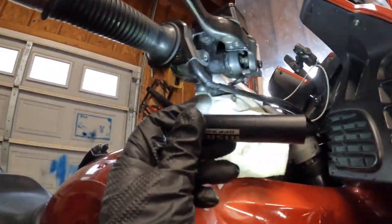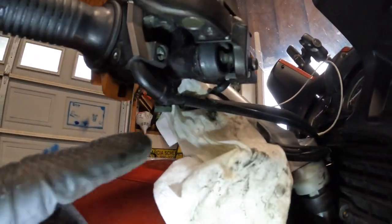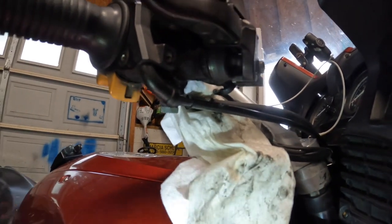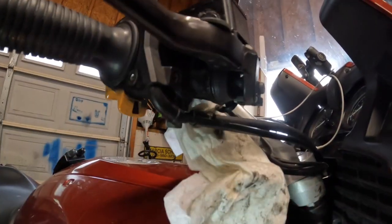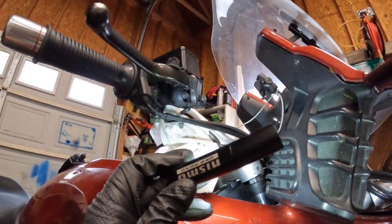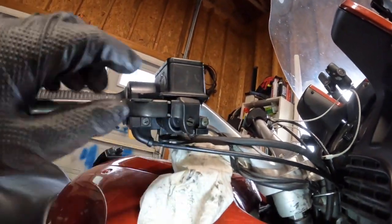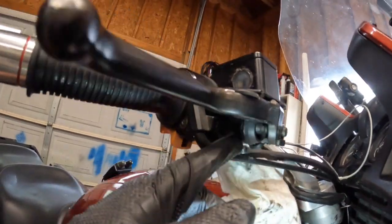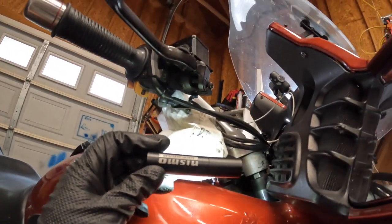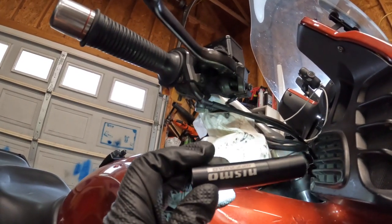Alright, I hope you can see up under here. You can see where the master cylinder is leaking — that's where it's leaking up under here. We're going to take that apart. It does look like it might be pretty easy to do on the bike. There's a screw here that holds the switch on and that's the adjustment screw, so you could probably just pull the pivot screw out for the handle. I'll look at it a little better. I'm just going to cover up the paintwork because I don't want any more damage than already is.